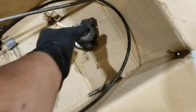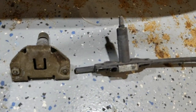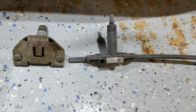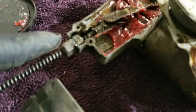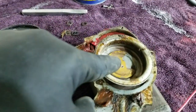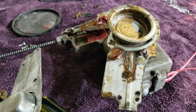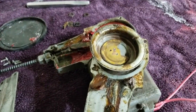Here is the assembly that comes with the MGA — you can see how much smaller the posts are compared to the TR7's. That cable will run through these. This is what screws on to the end of the motor. I believe this is the breaker mechanism — if the windshield motor doesn't turn correctly or only has a minimal sweep, this is what you adjust by loosening the cover and turning this.